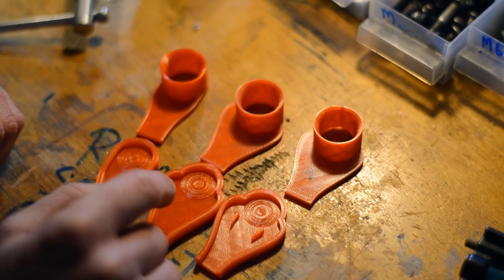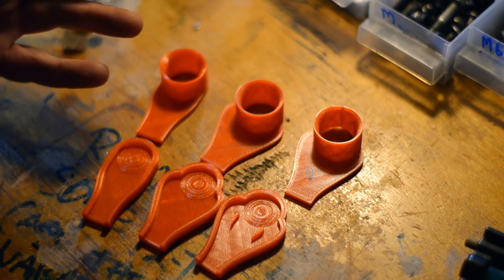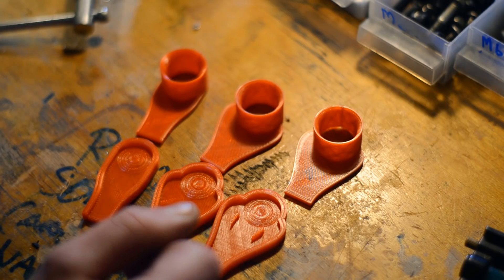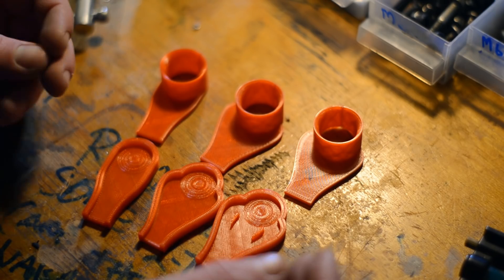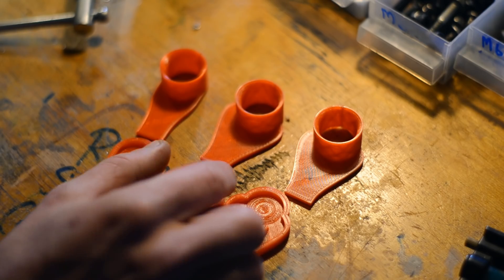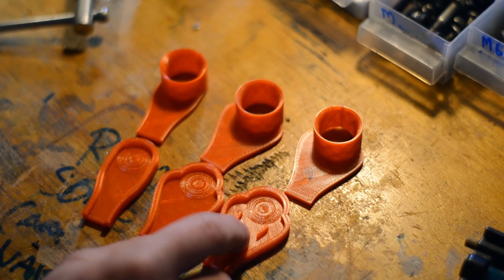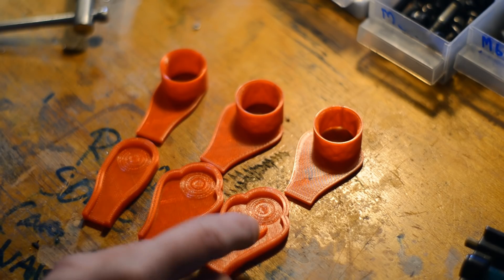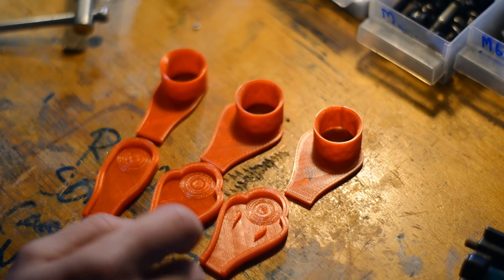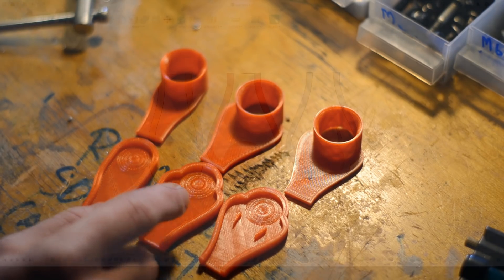In the meantime, I've been thinking about my exhaust duct design. I haven't used CFD — I've used IFD, Intuitive Fluid Dynamics — and intuition and two-strokes seldom match very well. What I've been thinking about is whether this bulging exhaust duct, like you see in three-port designs, will actually flow like a three-port design, or if it will cause a lot of turbulence. It's much easier to see in the CAD model.